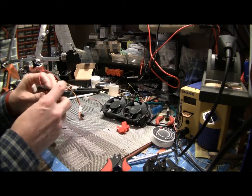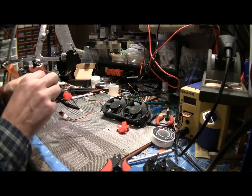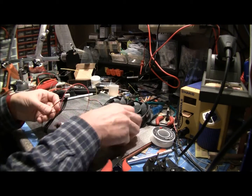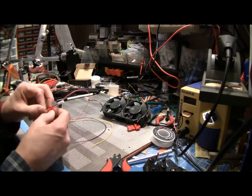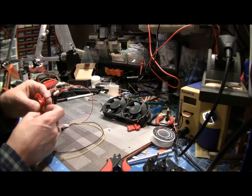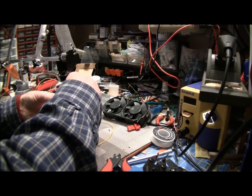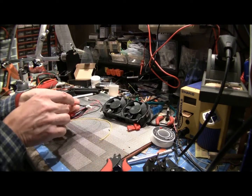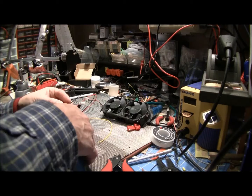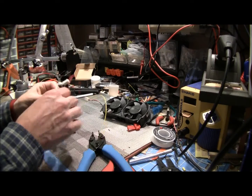We're going to crimp into the positive voltage with the red wire, and then we're going to crimp into the negative line with the black wire. Now when you crimp these in, you're going to want to keep them up towards the DVD drive side. So if you pick the one end to be your motherboard end, go ahead and use the other end as your closer position for wiring that up. You want to try and keep your wires in the right slots here so that when we crimp them they split up properly. Once you grab them in there, they should be good.